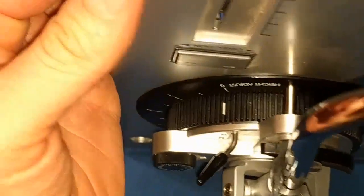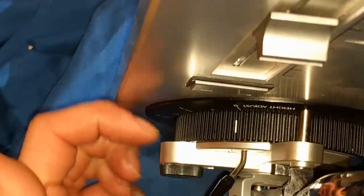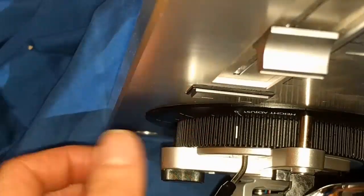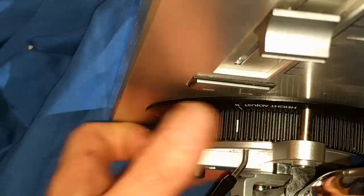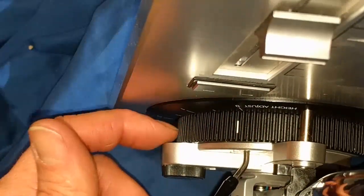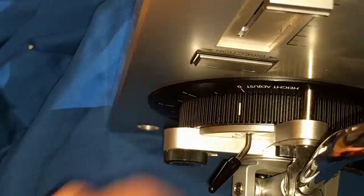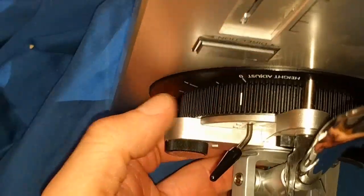And then the other thing I wanted to show was how to properly calibrate your arm base so that it actually lifts appropriately at the right notch. Now, when you look at this at zero, you'll see the bottom of this is basically hitting this knurled nut adjustment, this very large threaded adjustment. And that is the stop from when it hits zero. That's actually how you know it's hitting zero.